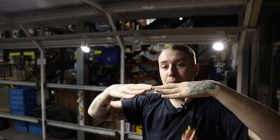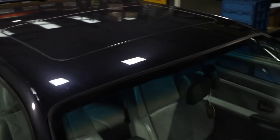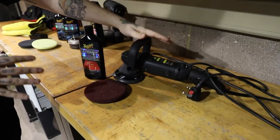You want to bring everything to the same level to make sure the defects are gone. You can clearly see there are a lot of scratches on the bonnet, and real swirly marks on the roof as well. What it actually is are scratches and marks going every direction, and the way the light hits it gives the swirl appearance. So the first thing we need to do is evaluate the surface and choose the right product. We've evaluated the surface and done a test panel — I'm using our MT320 and various pads.